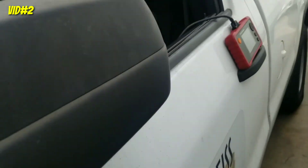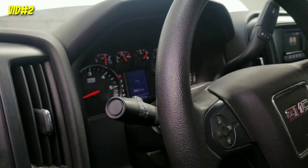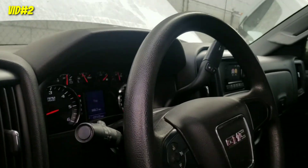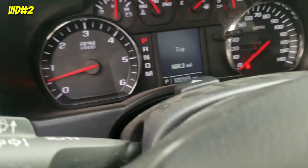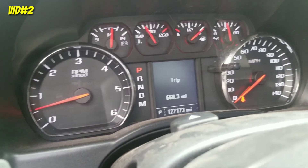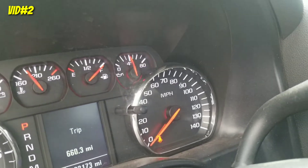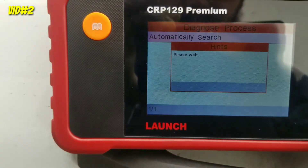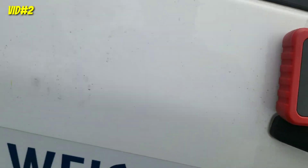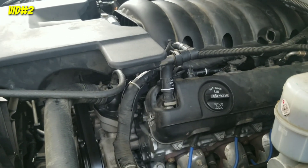Thanks for watching. If you like the videos, you can show support by leaving a like and comments. If you think my videos are worth it, share them. Here's the dashboard at 600 RPM: good battery voltage, temperature around 170–180, full gas. Oil pressure is about 40 PSI. I hooked up the scanner — no codes, no misfires, everything seems good. That's all it took. Again, thank you for watching — see you on the next video.